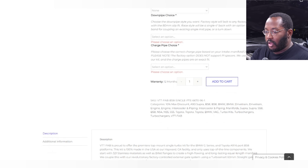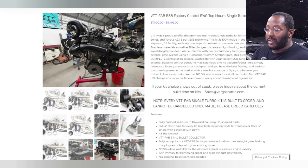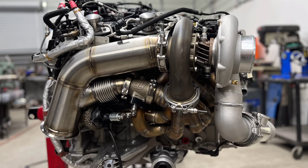Overall, I think this is a really cool option. It's expensive, but if this is a priority for you, it's probably worth the money, especially because there aren't really a lot of other turbo options like this. There is a B58 and S58 option, so whether you have a 340i, 440i, Supra, M3, or M4, there are options for everybody. The only difference is if your car has an S58, you'll have to disable one of the electronic wastegates in your tune. For us B58 guys with single turbos, it'll just be plug and play. Hopefully this gives you the information you were looking for — thanks for watching, and leave any questions in the comments below.